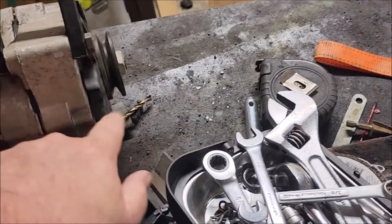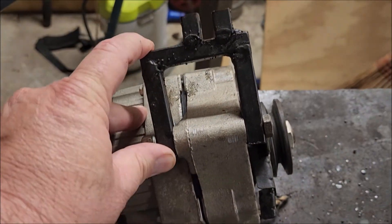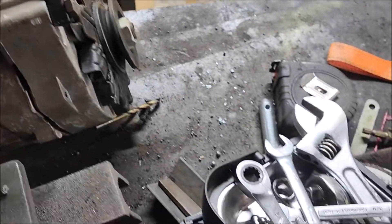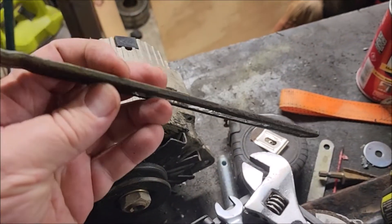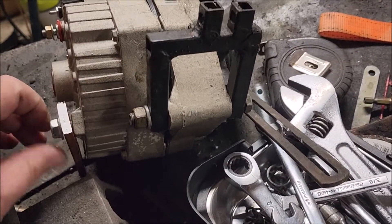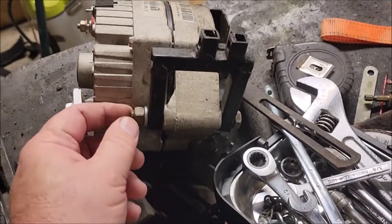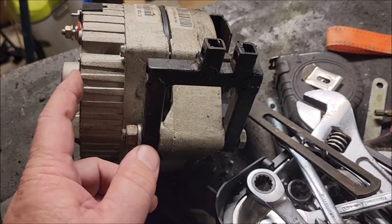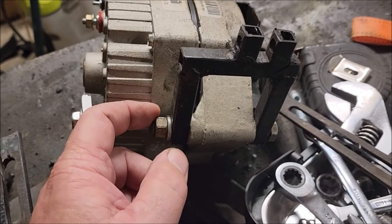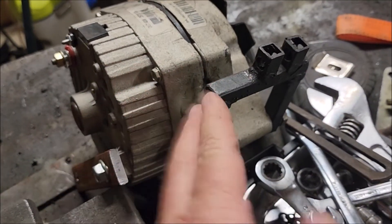When I was driving around, the alternator was hitting the fan, and under load it was bouncing around a lot. So I took it out — somebody had made this bracket, which is cool and it works, but this bracket on the top side was very thin. I made a new bracket for the top. Then I got to looking at the bottom and I was working on another bracket, but I went online while I was having lunch and for like 40 bucks they make a bracket for the inline six-cylinder Dodge motor that bolts right to the lower generator bracket — perfect alignment and everything. I'll still use this top bracket, or I got another Chevy upper bracket somewhere.